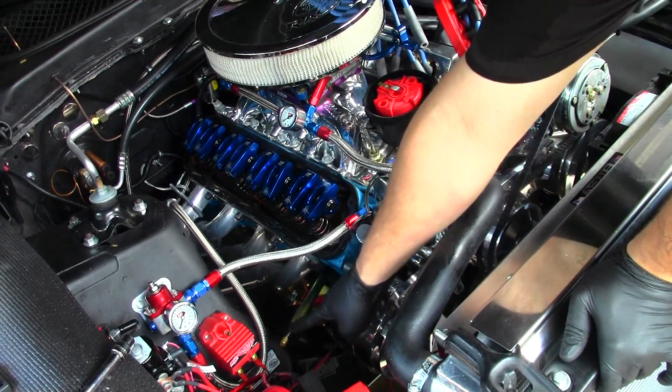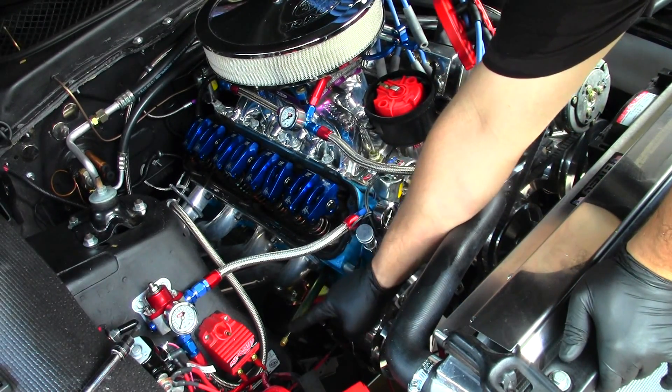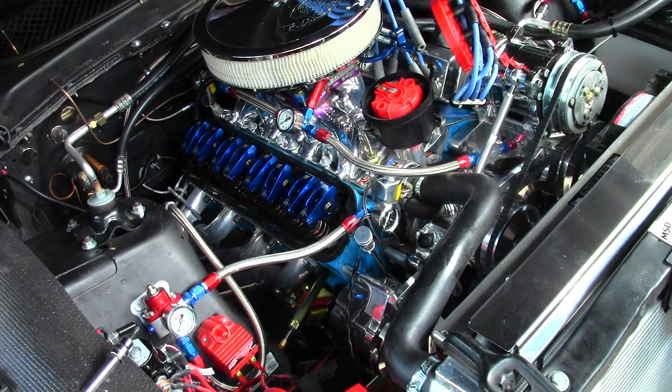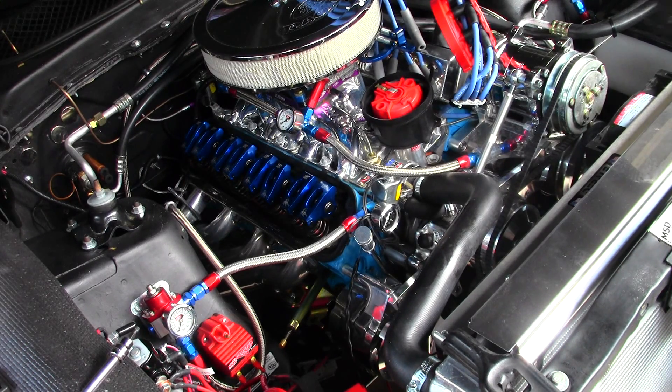This is going to move up and down because it's directly in contact with the piston. So let me go ahead and rotate the engine now clockwise, which is the way a Ford motor turns, and I'm going to show you how you know when you're at top dead center compression stroke and 180 degrees out.